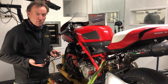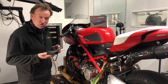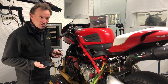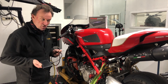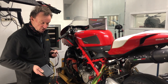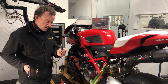The benefit is that you don't have to come here with your bike and get a custom dyno tune. For people that don't live locally or can't get here for whatever reason, this is a genuine option. These tunes are all developed right here in Melbourne for our fuels, our model bikes, and we've tested them fairly extensively. So we know that if I send this with the tune loaded to the same model bike in the Northern Territory, it's going to be within 2% of what it is here on the dyno.